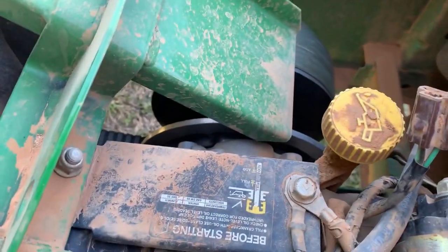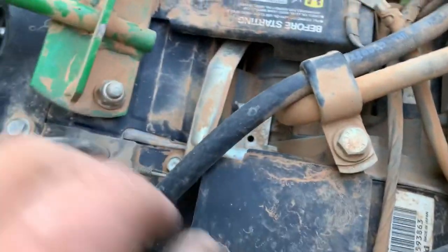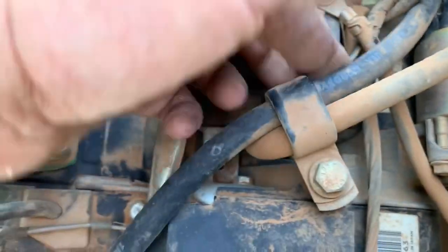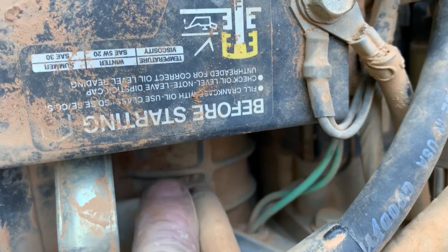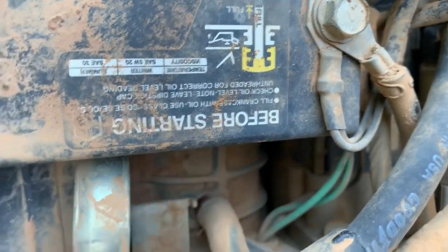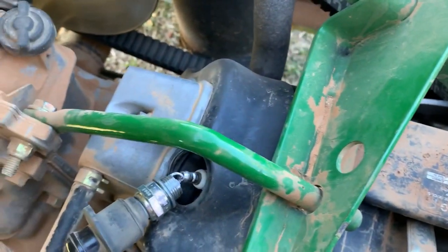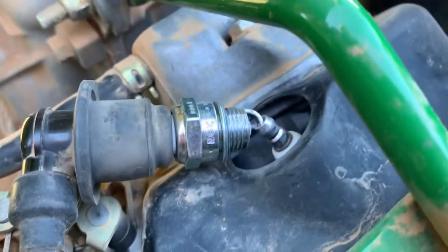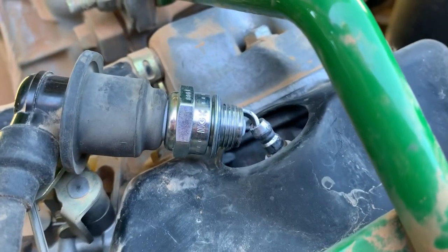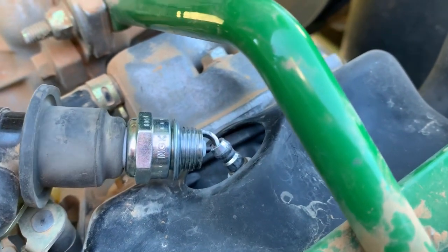This plug goes straight into the engine right here with a rubber grommet — you've got your two charge wires and the kill wire going into the engine. I've modified this spark plug so that we can see the spark, and I'm hoping we can capture it. I'm going to crank it and it'll lose fire and die.